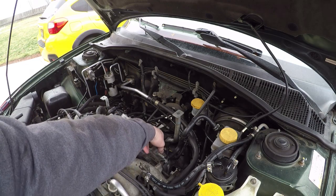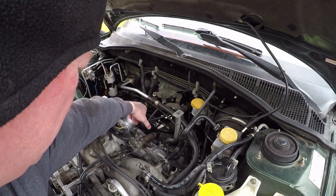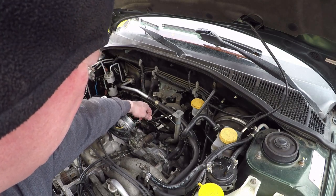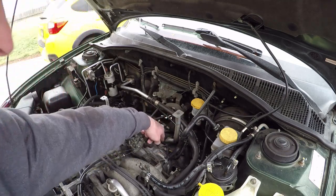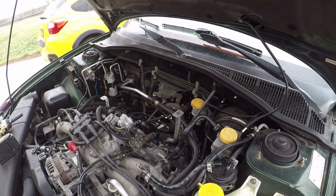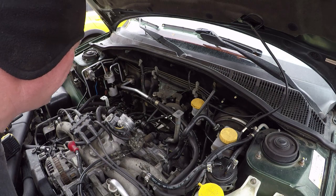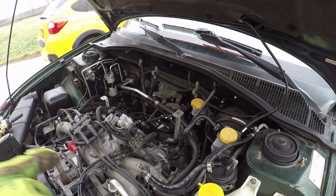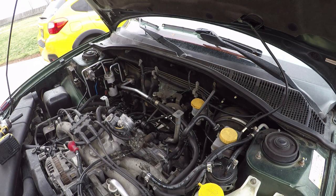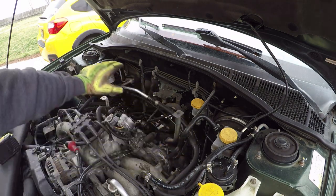See the dog bone here. We've got to disconnect this bolt. Oop, it's not tight anyway. And then you've got to disconnect this. Starter down here is some of the transmission mount bolts to the motor. A couple wire connections. Part of the wiring harness that is the transmission neutral and reverse, as well as on the left, passenger side, left side over here.